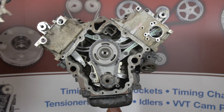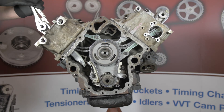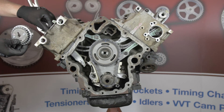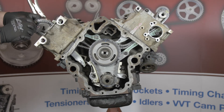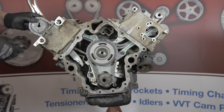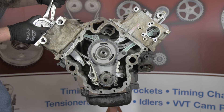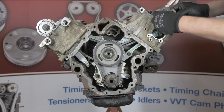To install the camshaft sprockets, the camshafts will need to be rotated. Using the same process used to remove the cam sprockets, clamp your tool onto the cam in a position to allow for proper rotation. Engage the right hand cam sprocket onto the chain, aligning the R marked dot to the marked chain link. While holding the cam sprocket and chain, clip or cut the zip tie for that bank and rotate the camshaft to engage the camshaft dowel into the sprocket. Install the camshaft sprocket bolt, but do not torque at this time. Repeat this process on the left bank.